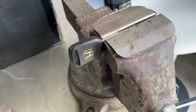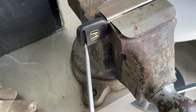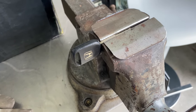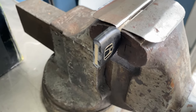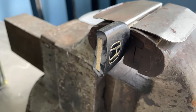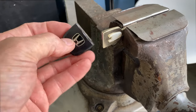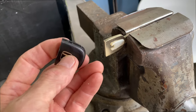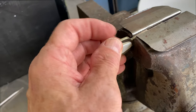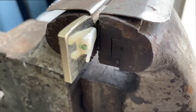So we have the key in the vise here and you can take a razor knife and cut these two ends off. Then I'm going to cut right along the top of this seam here. You can see where I've cut the back loop of the key off — there's the back portion, the metal portion right there. So I'm going to cut along that seam and pry it apart. Here you can see I've cut the bottom off, slid it across the top, pried it apart with a screwdriver, and slid it off the key. And this is your transponder right in there.